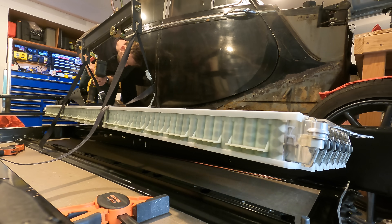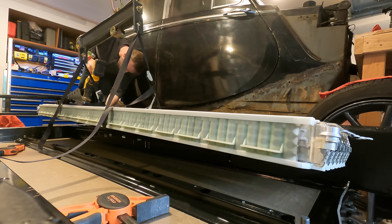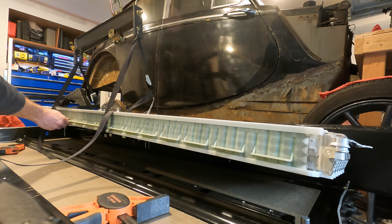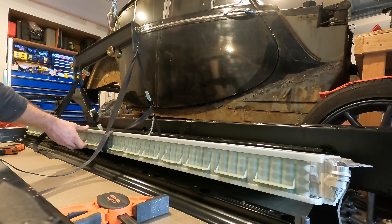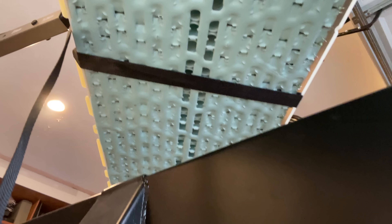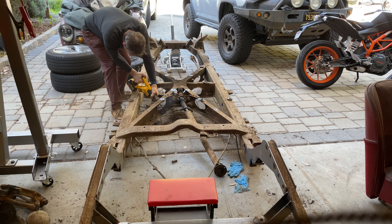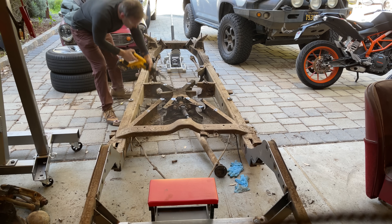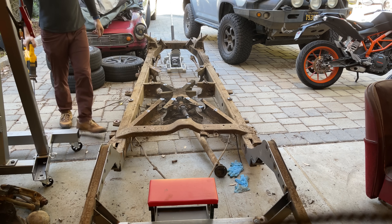Getting the modules installed in the car was not super easy, given the fact that they are extremely long. I got the smaller battery, which has fewer cells, but Tesla doesn't really make them easier to repackage — they just remove the cells from the middle two rows, so the medium range and long range modules are the same size. Still, I managed to get them all packaged in the car, mostly within the existing frame with a slight frame modification and lifting the body up about half an inch off the frame.